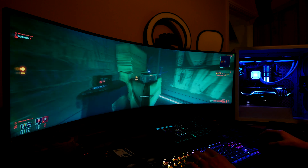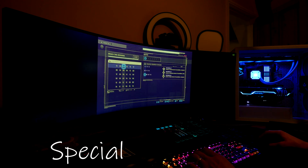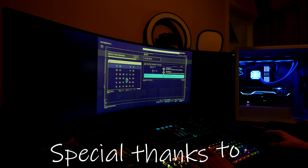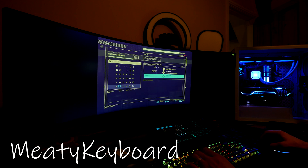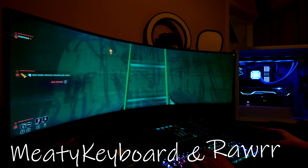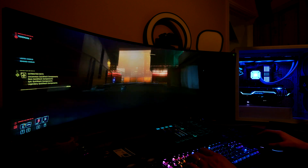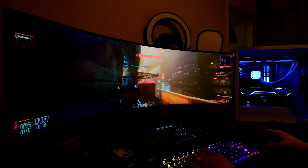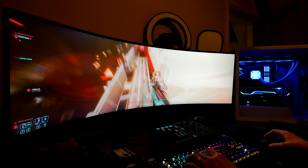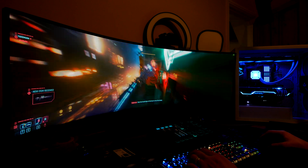For Time Spy Ultra I got 69°C originally and then 74°C with two fans. I also ran Cyberpunk 2077 on Samsung's Odyssey G9 at maximum resolution with maximum graphics settings, getting about 45 FPS — a pretty taxing test. I found temperatures of between 63–73°C on the graphics card and about 76°C on the CPU. Although toasty, nowhere near as hot as I was expecting, and the end result is actually surprising: you can run this case with those two fans and get good performance.